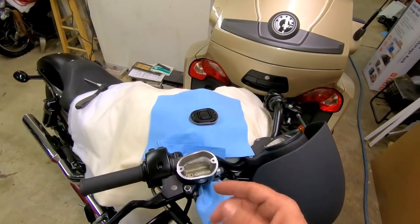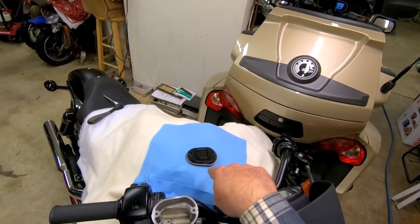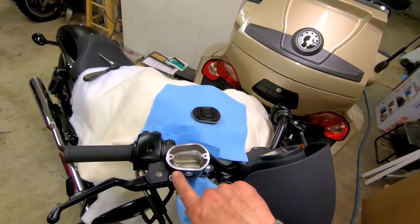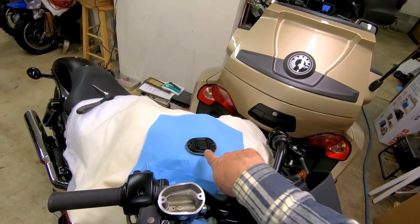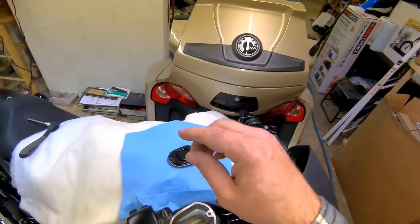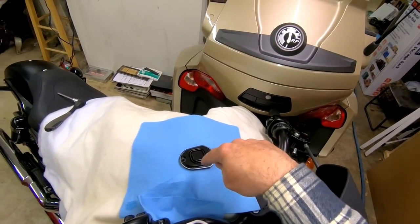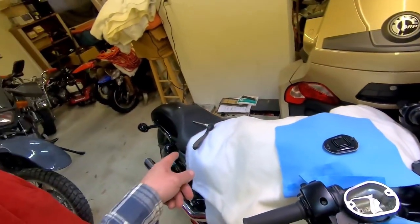From here I need to go in and wash and thoroughly dry that with water. Don't ever take a cap off and stick it back on — it will not seal, and if it does seal it's out of pure luck. What happens is the brake fluid will weep, and even though there's a good powder coating on these master cylinders it will eat through it. You'll see people all the time with the paint all flaked on their cap and around their reservoir where that thing has leaked. You have to wash it off with water — water just dissolves brake fluid immediately. That's why it's so important to flush these often. Leave it low, go in, wash it out, dry it out thoroughly, and then come back with a dry cap, top it off.